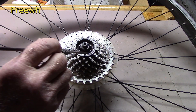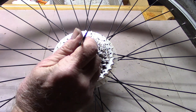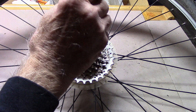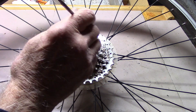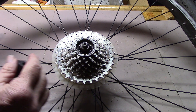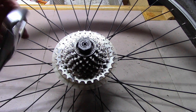On the other hand, the freewheel has no lock ring with grooves to remove. But rather, deep down inside, we see these grooves running vertically all the way around. Some freewheels will have notches in them, two or four. It depends on the freewheel itself as to the type of removal tool. In this case, the notches are down inside, and we can use a Shimano removal tool.